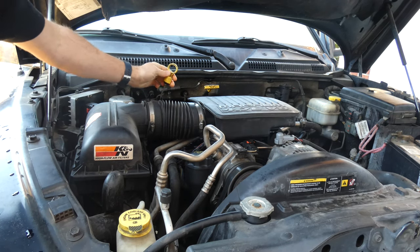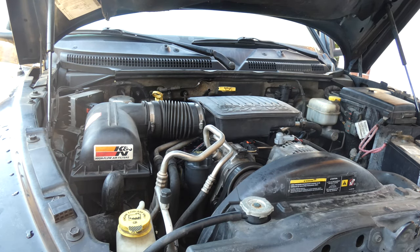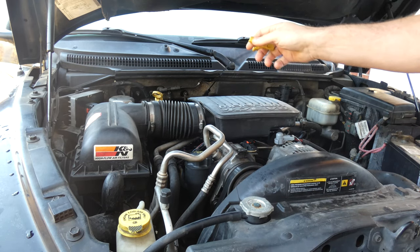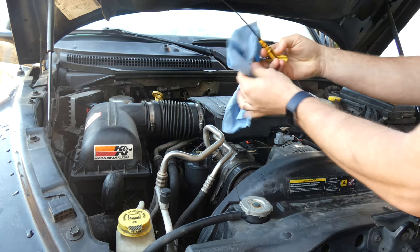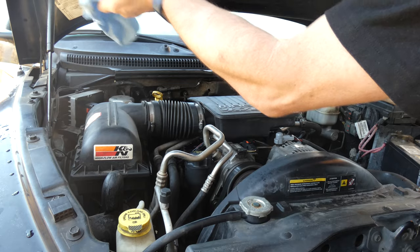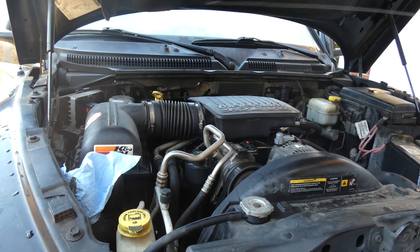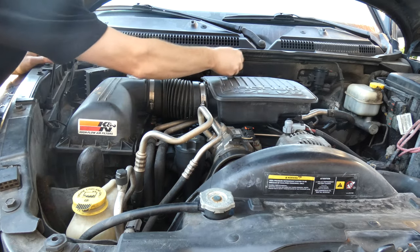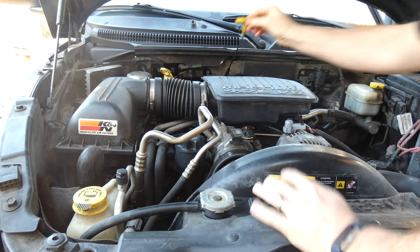On this vehicle you'll see right here — this is the dipstick for checking the transmission oil; it actually says 'trans' on it. This one has a picture of an oil can. Some cars differ, but you should always be able to find them. If you're unsure, take a look in your owner's manual or look it up online. First thing you do is pull the dipstick out of the vehicle and wipe it clean with a lint-free cloth — I'm using a shop towel. People love to use paper towels and napkins, even though you shouldn't because they contain lint. After you've cleaned the dipstick off, insert it all the way in as far as it'll go — that's very important.